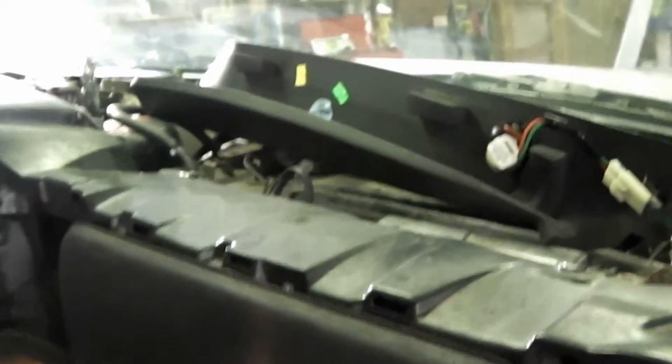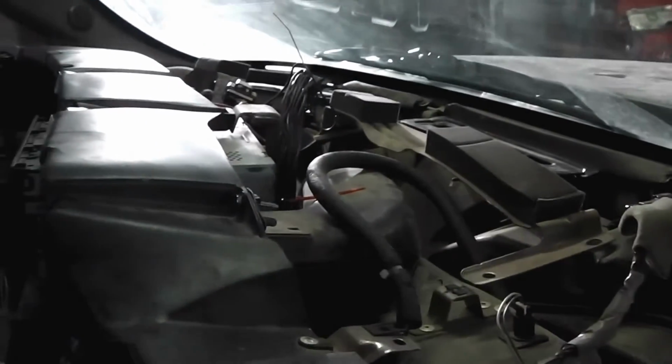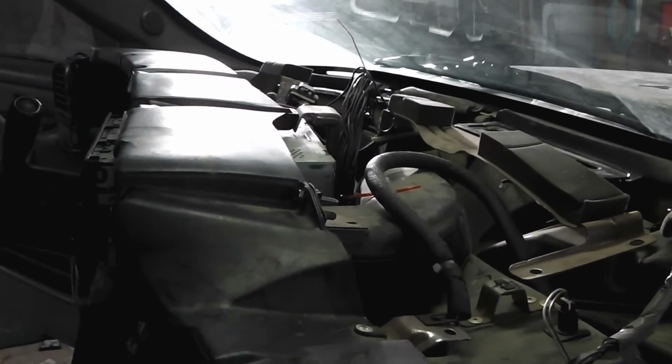If you're a Chevy guy, I'll show you how to pull that dash part off. That part's easy. And even the big part, it looks daunting and it looks like it might take a bit, but when you get it, there's just two clips. There's clips there. Pop it back in. No big deal. Same with these ones. It's just a circular clip that pops up into here. They'll fit in when the dash goes back in. That's just the thing for the subs. It's crossover. Some wiring there. Other than that, that's the basic thing.